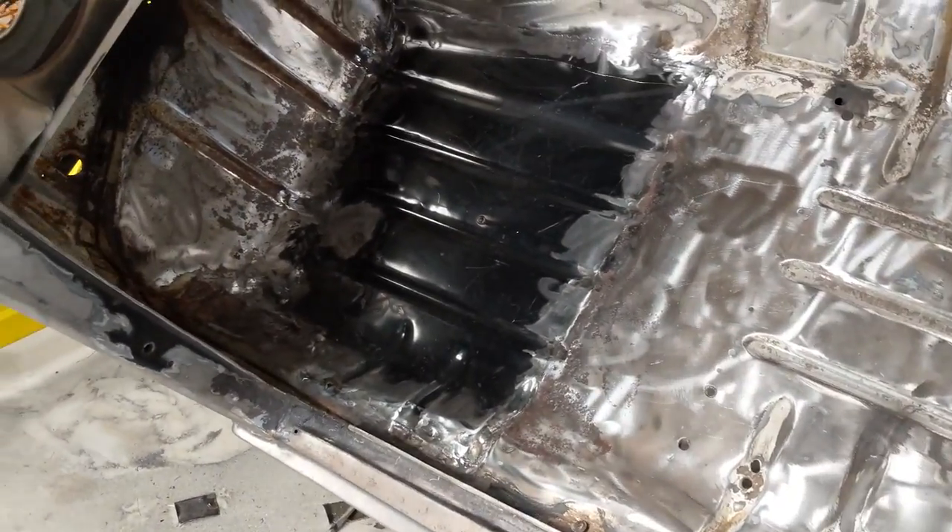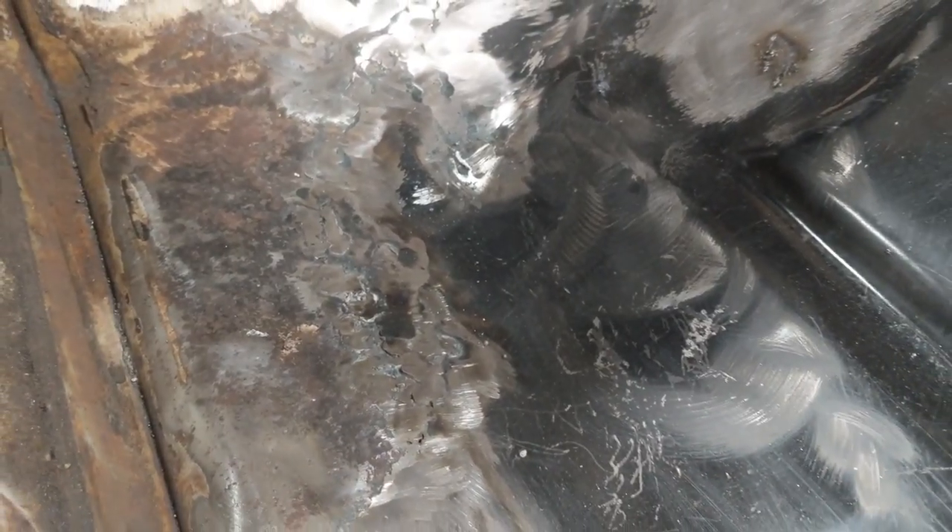The floor pan is in. Pretty happy with it. It's pretty rough compared to the other panels, but it's not going to be seen — it just has to be structural. I took it as far as I could in the rusty areas, and I got into a bit of strife chasing holes left, right and centre. That brace running behind there makes it really hard to put the whole section in without unpicking all those spot welds and taking it all out. Although that's not ideal, I managed to recover all those holes — basically made big puddles and filled it all in — so it's strong now.